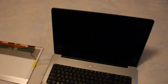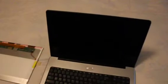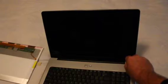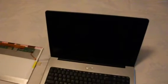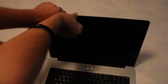Before beginning, remember to take out the laptop battery. Start by removing the bezel screws — one on the left, one on the right. The ones on this computer have already been removed, but I'm just pointing out where they are. You may have little black stickers covering the bezel screws; you can just remove those to get access to the screws. Then pop off the bezel.